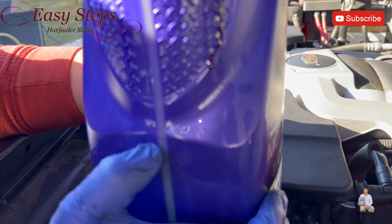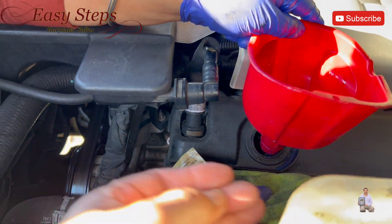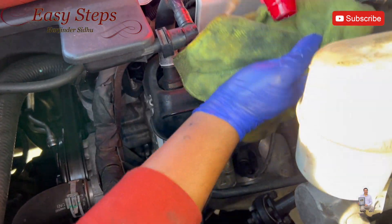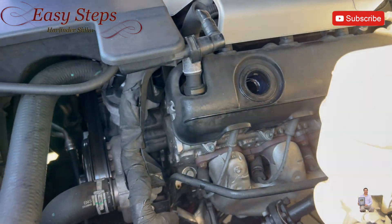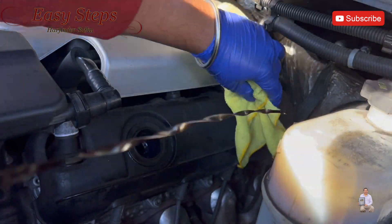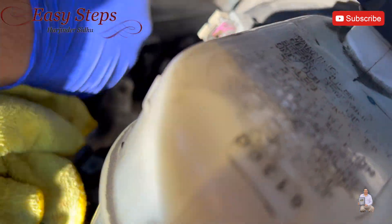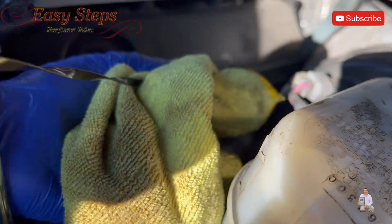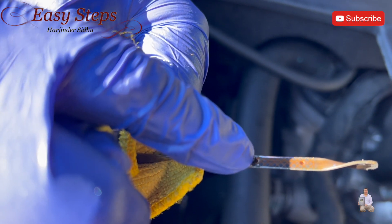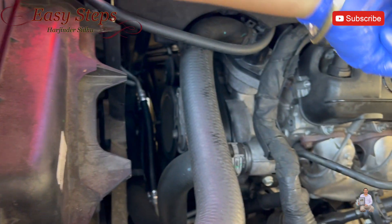As you can see, at three quarts it stopped. Now we're going to measure the oil level. Remove the dipstick, then check the oil level — take out your dipstick, insert it back in. As you can see, we're on the max line — it's perfect. When you're at the max line, that means you've added eight and a half quarts.